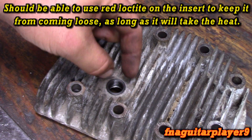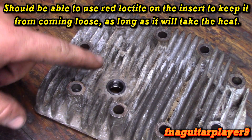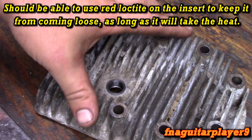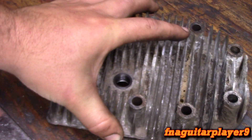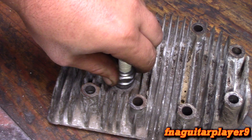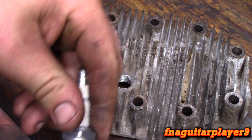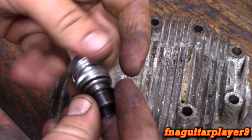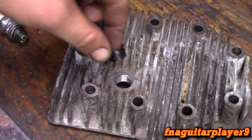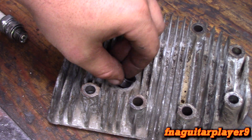Here's the oversized spark plug hole now. Just run the insert down by hand like this, and then it'll tighten when you put your spark plug in. There's a slight chance it'll come out when you remove the spark plug — you can see it's just about right, so now it's fixed. It is coming out with the spark plug; that's why I was saying there's no tool to tighten the thread inserts. That just comes with this type. Once you get it tight, it might actually tighten in there.